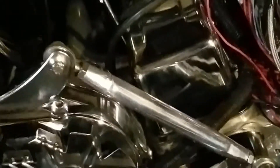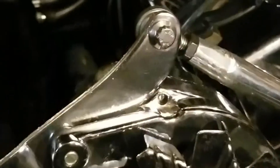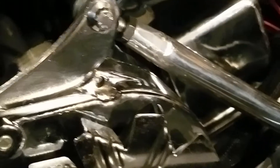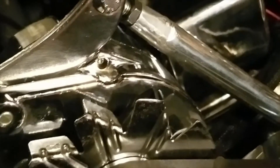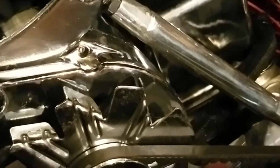The alternator on the driver's side would in my opinion be in the way when I need to fill or check the power steering. Now, when doing this build, two things to watch out for: the spacing between the valve cover and the alternator itself is probably three-quarters of an inch, maybe an inch. The other area to watch is down by the A-arm. For most vehicles it's probably not a problem, but I've read that on an '82 Corvette, that more expensive bracket puts the alternator right where it hits the A-arm.